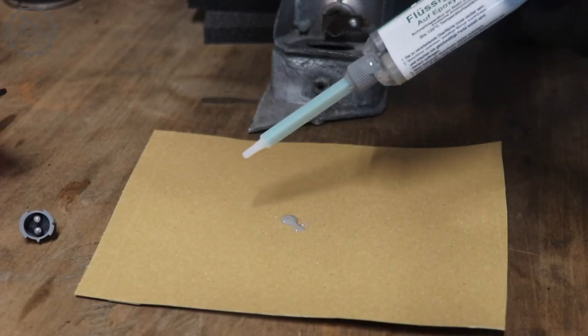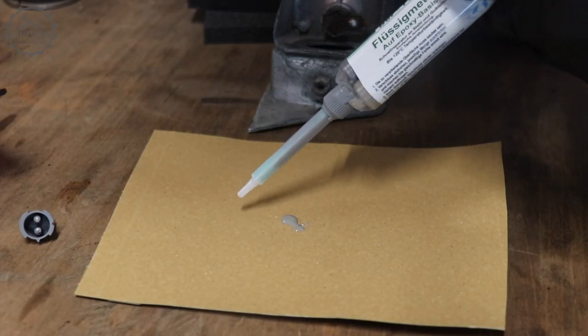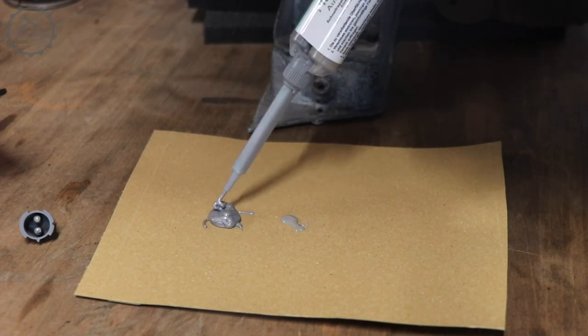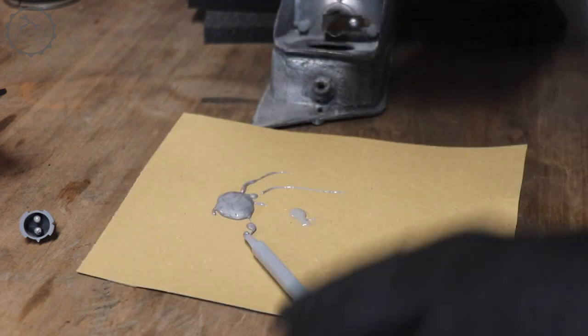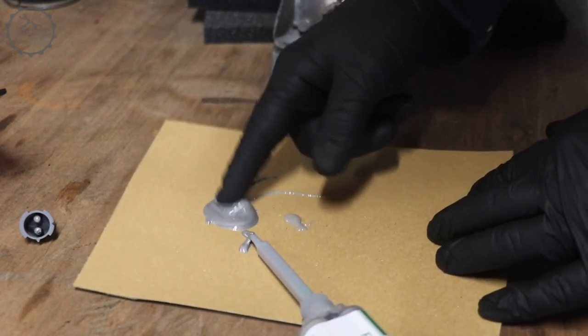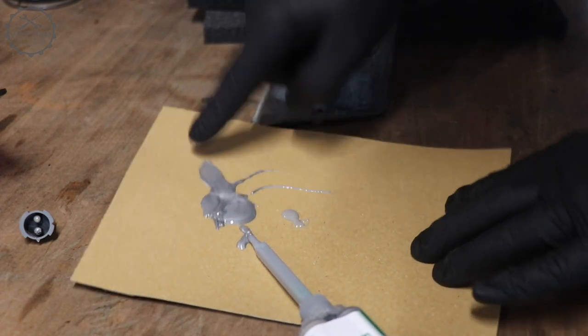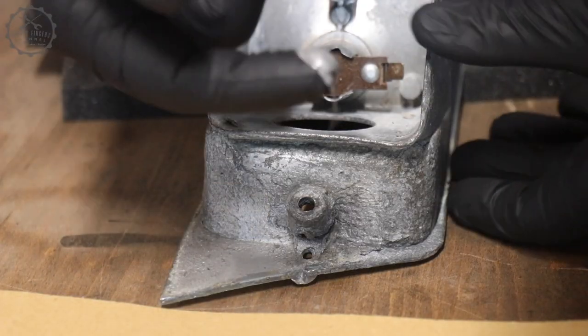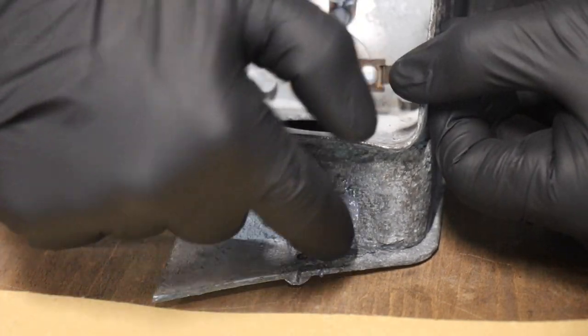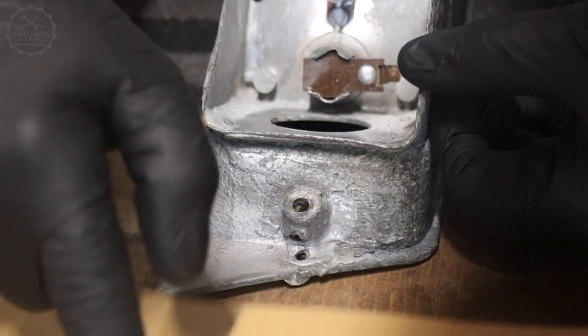I first had little hope that I'd find a proper method of repair, but then I remembered the so-called liquid metal, which in the past I sometimes used to fill unwanted screw holes. And it worked. It worked impeccably. It's basically a two-component epoxy resin that contains enough metal powder to give it the thermomechanical properties of real metal.